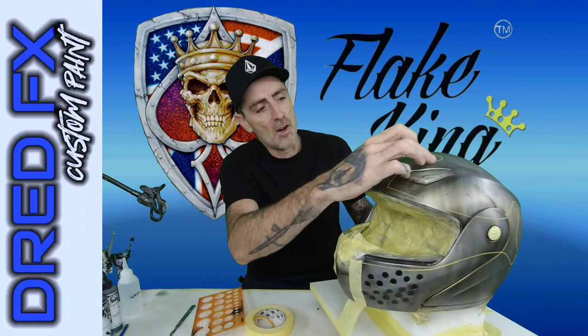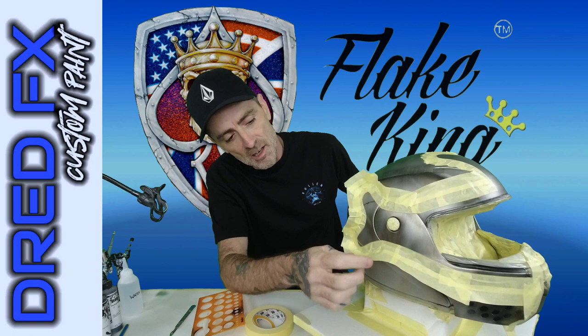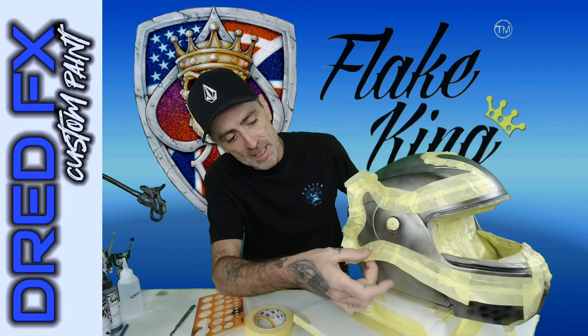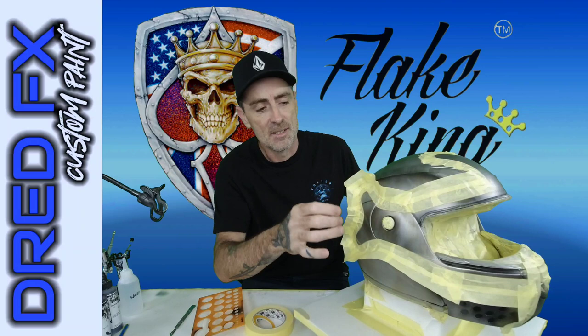Now, once you've dropped the fine line down, because we're spraying on this inside, you've got to mask the fine line off and mask the rest of the helmet off. As you can see here, I've gone round with some inch tape, sat that on top of the fine line and made a sort of pocket. So when you spray in here, none of the overspray is going to go onto your crash helmet, and you'd get a lot of colour on there if you didn't have this. So that's where the candy gold's going, all the way around.